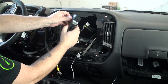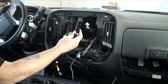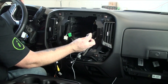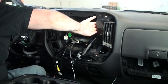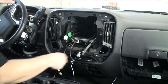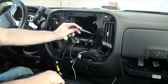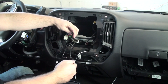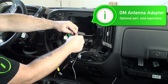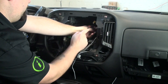This whole system is kind of bulky for what we're going to do, so we need to get it out of the way. This was also in the OEM radio — it's a plug that's not being used, so that can go out of the way. Next, we have the FM antenna. The FM antenna from GM doesn't match an aftermarket radio, so we'll be using this adapter. We just plug it in and I'm going to run it the same way I ran the satellite radio.